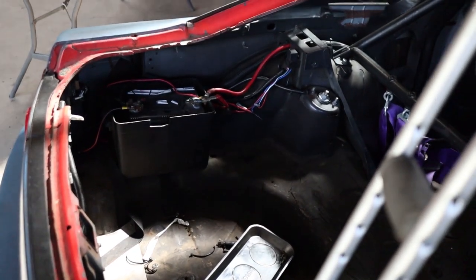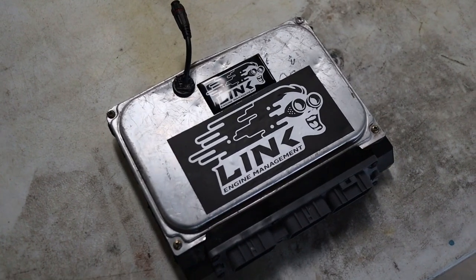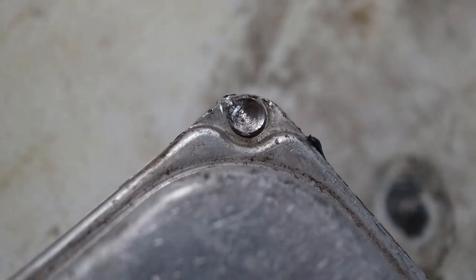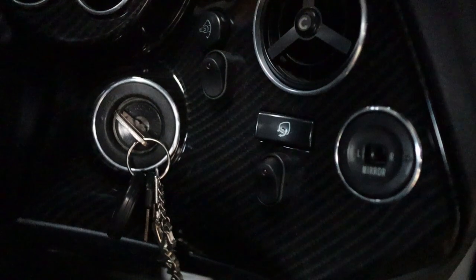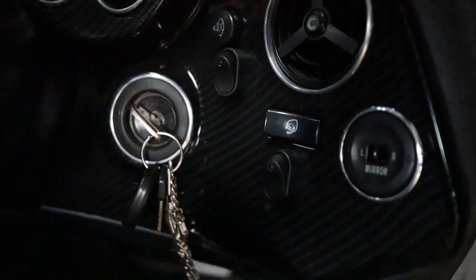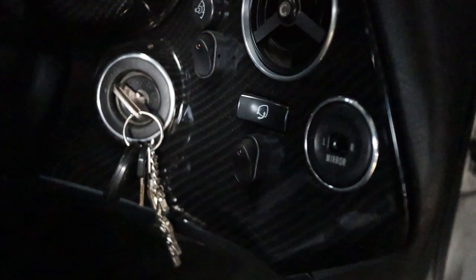So with that being sorted, we started getting the 180 sorted, started pulling out the fuel pump hanger and getting it all fixed up, getting it ready to go. I redid a lot of the fuel pump wiring. We replaced the bulkheads in the hanger, all that sort of fun stuff. This was me looking at the Supra Link on how we can actually get inputs into that. We need a little expansion loom, which I've since got from Whitey's Wiring, which is awesome.